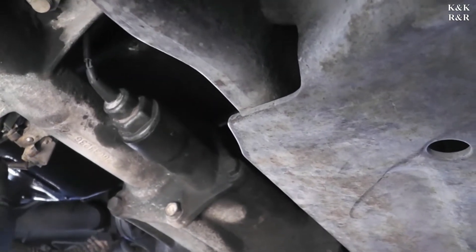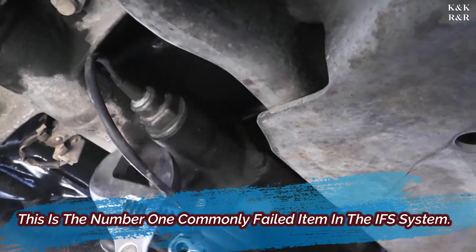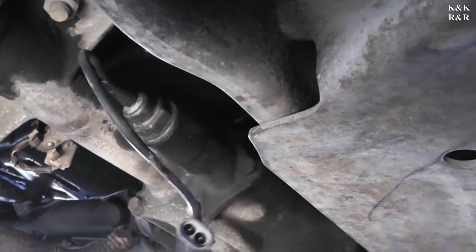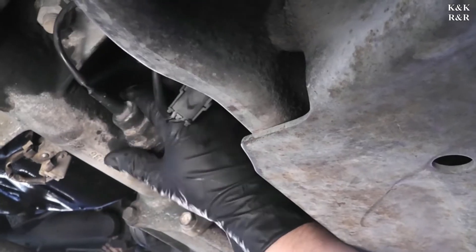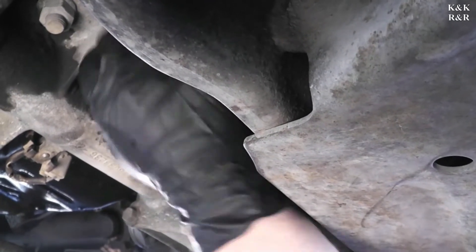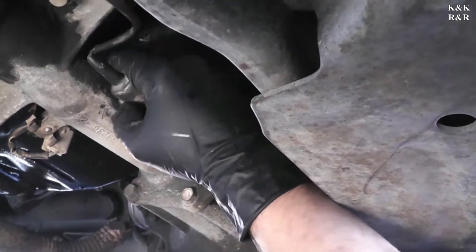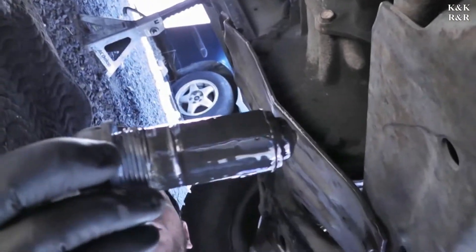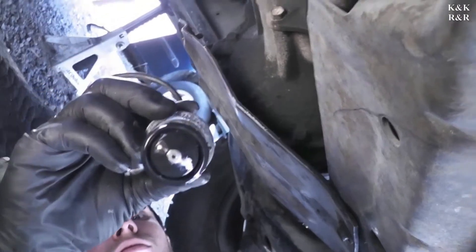Now that you've diagnosed your front actuator is dead, we're going to go ahead and remove it. This is going to be one of the few times I'm going to say it's okay to use a crescent wrench. This is the number one common problem with the IFS — in a second I'll show you the other common problem. A little bit of grease may pop out and that's okay. Probably a good time while you've got it in the air to service it and see if it needs fluid.